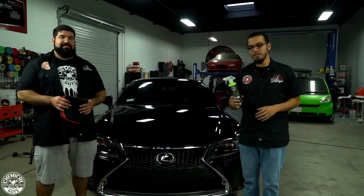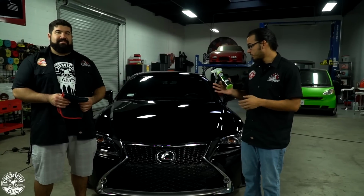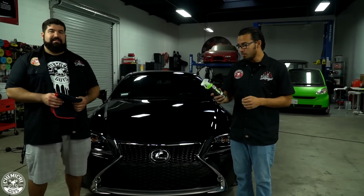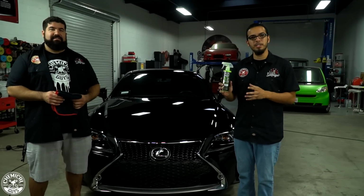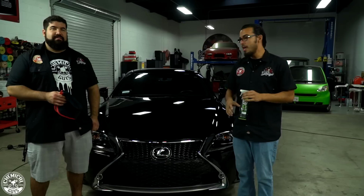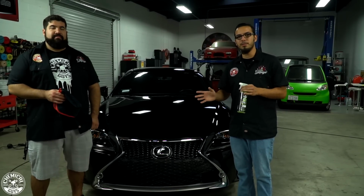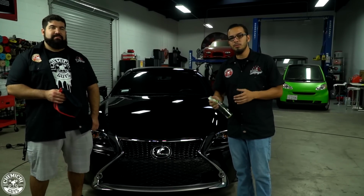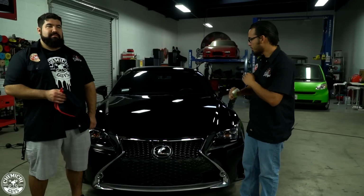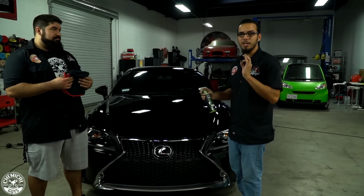So as a final step, we want to go ahead and hit the whole car with a quick detail spray. This is going to take any last fingerprints, dust, debris, or anything we might have missed. It really picks up anything that's on the surface. So we're going to use our new C9 Vitalize Quick Detail Spray. This is a sealant enhancing, gloss enhancing, paint protectant. It's going to really make this black pop, and it's going to pick up any loose dirt, debris, or dust that's on the surface without scratching. So all I have to do is shake it up, and then we'll spray it on the surface. Jeremy will follow me around with the towel, picking up all the extra product, and we'll get the shine perfect.